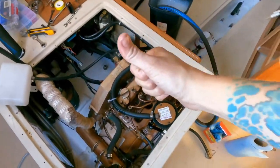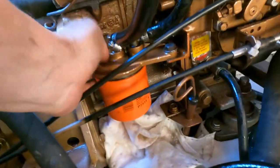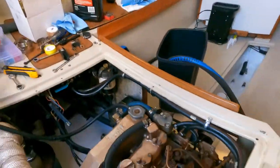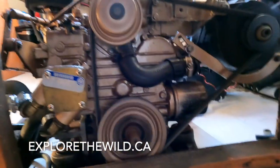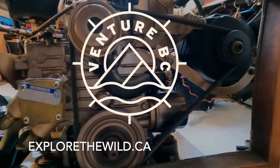Don't forget to check for leaks on both fuel filters and the vent screw. A common area for leaking is the O-rings. Often when you remove the old filter, the old O-ring can get stuck to the housing, so make sure you remove the old O-ring with the old filter. Don't forget to subscribe if you enjoyed the do-it-yourself maintenance video, and if you have any specific videos you'd like to see in the future.